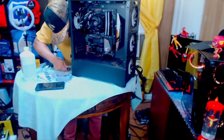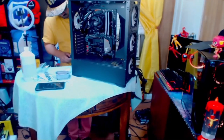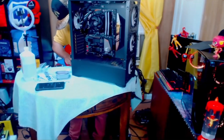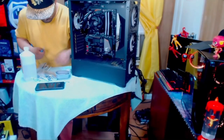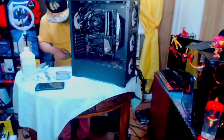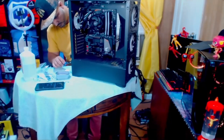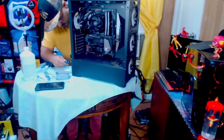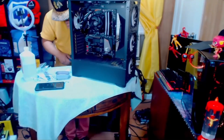A lot of these motherboards come with two power sockets — an 8-pin and a 4-pin. I noticed that a lot of times I was just plugging in the 8-pin and leaving the 4-pin out, and then you get some crashes. Games can run on just an 8-pin, but my X570 is on just an 8-pin and I think today I'm going to take it apart and plug in the other one, because it's starting to get heavier loads and crashing now that I'm playing heavier games like iRacing with the wheel bundle.